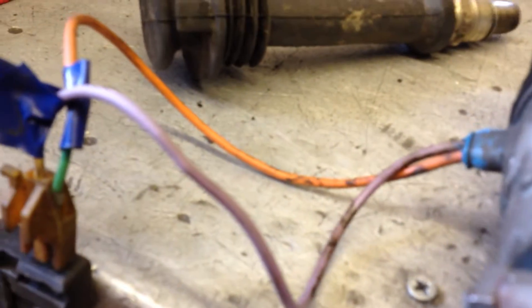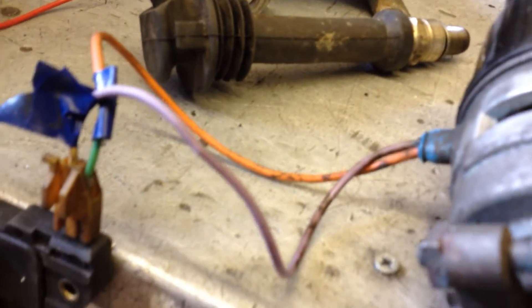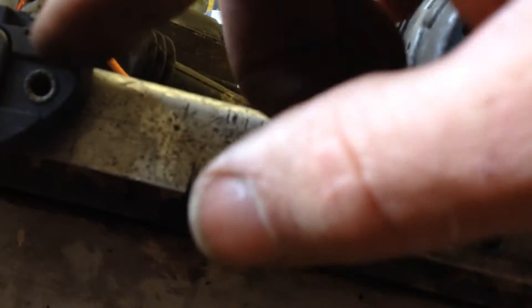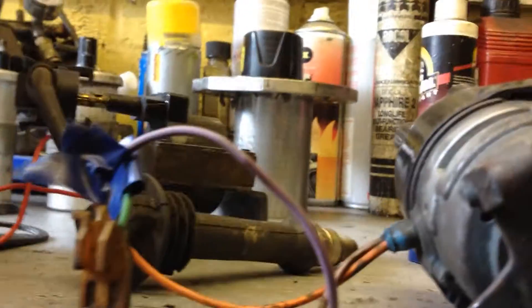What I've done is taken the orange and purple — or lilac, take your pick — leads, and plonked them into an Astra General Motors 4-pin Dufa ignition module, like so. Those are the P and the N terminals, which actually could stand for purple and orange in German.